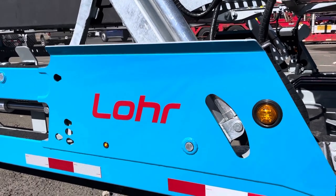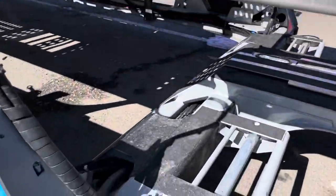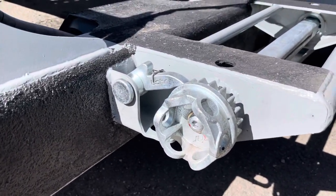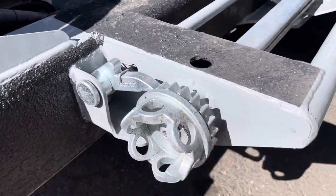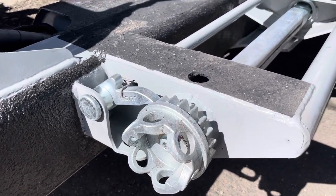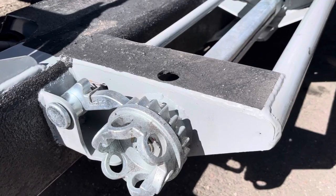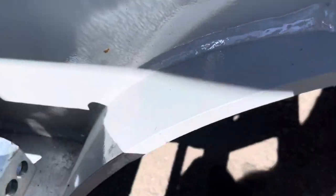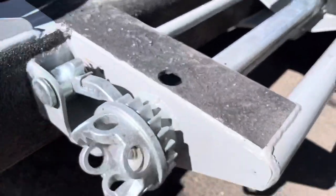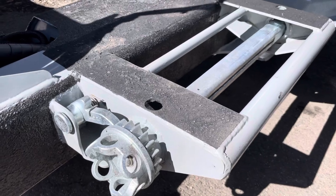I'm going to start with their ratchets. Their ratchets are galvanized steel. The advantage of galvanized steel is that chemically it cannot rust, so you won't have any rust issues. If a ratchet locks up or fails, you can either replace it — hammer out this push pin right here, slide it out, and replace it with a new one. You can keep a spare in the cab or call TransWest and we'll ship you one in 24 hours, next day basically.